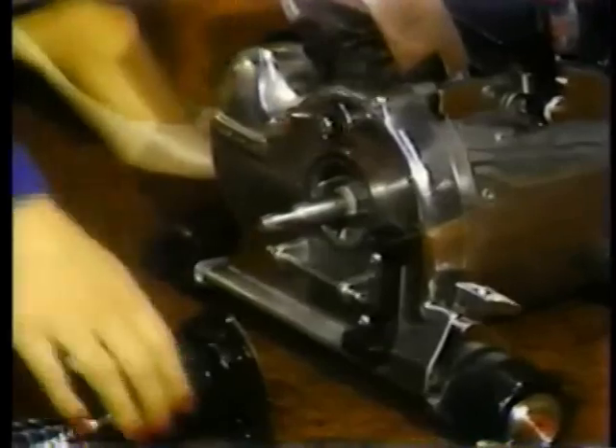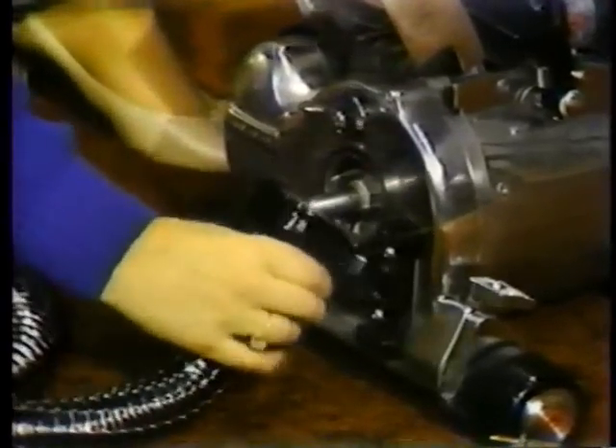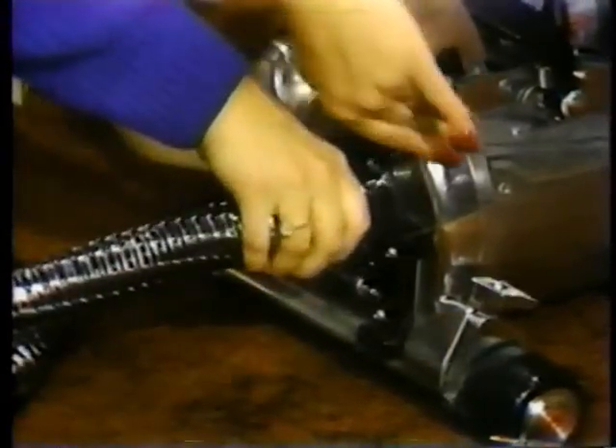To attach the hose, lift the headlight and hook the lugs over the attaching bar. Pivot the hose up against the power plant and lock it on. Lower the headlight and your Kirby is ready for cleaning with any of the hose attachments.